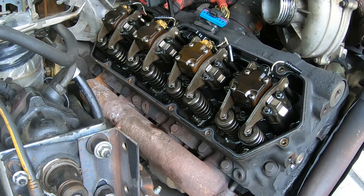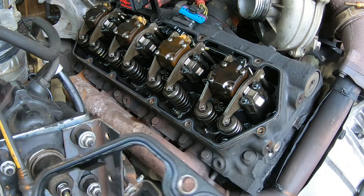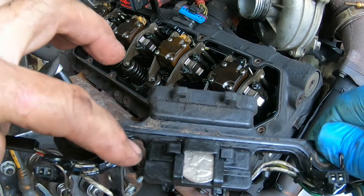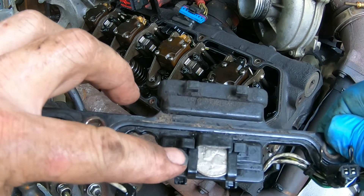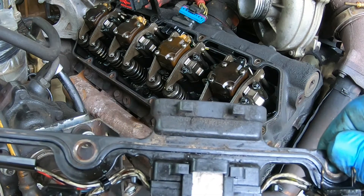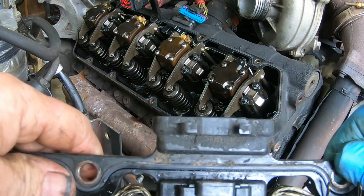I just got to get the wires hooked back up, get the covers on, then I'll go do the other side. One of the other things I'm going to do here — I don't know if any of y'all have heard what they call the 50-cent mod. On these connectors, this is where it plugs in from the engine harness for your injectors and the glow plugs. There's also a connector right here, and what happens sometimes is these connectors don't stay connected — the vibration from the engine will knock that thing loose.